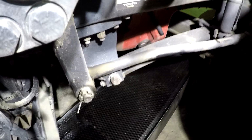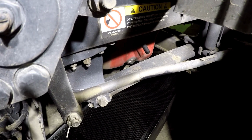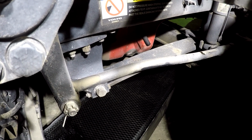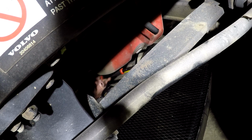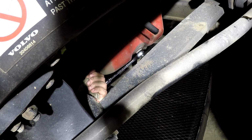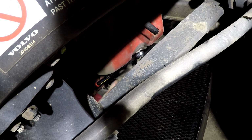So I've got the oil drain pan positioned right there. As you can see the drain plug down there, and I'm going to go ahead and drain the oil out first, and then we'll worry about getting the filter off. So these Cummins just take a 1/2 inch drive ratchet, it goes right in the plug right there. And I like to use an extended handle ratchet here because for whatever reason, these oil drain plugs always seem to be tighter than what you put them in there. And that extended handle really helps out.